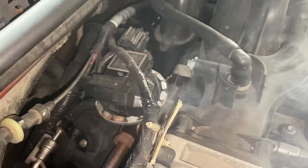One hour later — I went ahead and removed the old gasket and unbolted the EGR valve. I ran down to the local auto parts store and unfortunately they didn't have the exact same gasket for the 2008, but they did have one for an earlier model that is pretty much the same shape. The difference is the original is made out of aluminum, while the older style is made out of paper with metallic material — what you commonly find on exhaust systems. I think this thicker gasket might actually seal up a little better. The part number is Fel-Pro 70149.